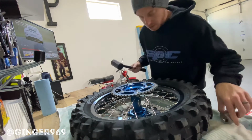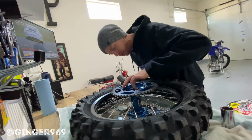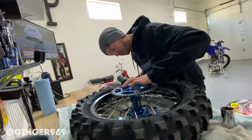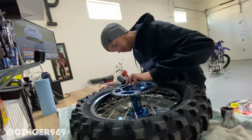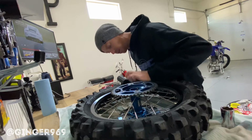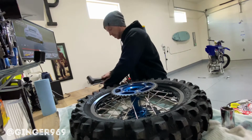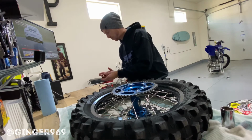You'll hear it set when it bases out, flattened or bottoms out on the interior of the wheel bearing or hub base. Make sure there's not a little bit of debris in there. Make sure that's cleaned out. And we'll put the other bearing in on top of it.